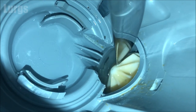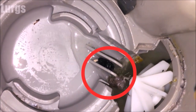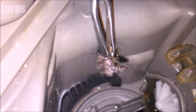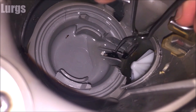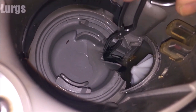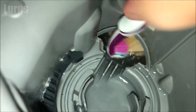What you're looking for in here is any blockages — this impeller should spin freely, and this one actually does, so that is good news. But here is a different model I was working on; you can see we've got lots of debris in here. Just take some tweezers and remove as much debris as you can — looks like we've got an old raisin or something. Be careful if you're putting your fingers down here — watch out for any broken glass or china that could cut your fingers. Then take your partner's toothbrush and give the area a good clean.